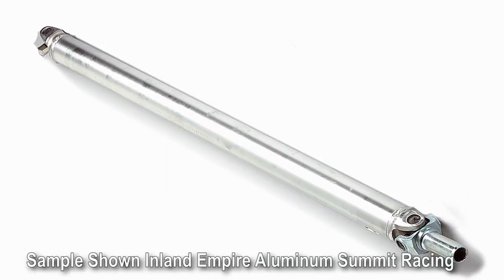Another thing you're going to need is a driveshaft. We like aluminum — on a classic car an aluminum driveshaft tends to knock out a lot of driveline vibrations. It's a little more expensive, but if you're doing a 4R70W why would you scrimp on that? We thought about using a Crown Vic driveshaft since it's the longest driveshaft in a late-model Ford, but it still wasn't long enough for the wagon. It might work on a Mustang since the Mustang driveshaft is a bit shorter than the Fairlane's.